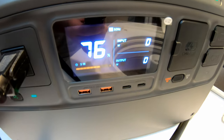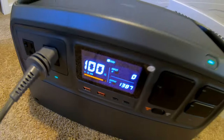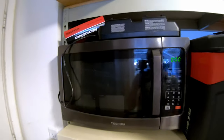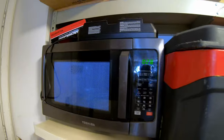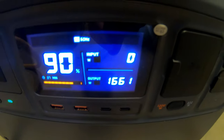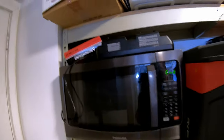Can the DJI Power 1000 run a full-size household vacuum cleaner? It has quite a bit of surge, though not as much as the dryer — I'm optimistic. Piece of cake, pulling just under 1400 watts. Can it run a microwave? The microwave is in my garage just for testing. Three, two, one — no struggle at all, pulling 1600 watts. This is the loudest I've heard this power station, but even still it's quieter than the microwave itself. Ran it for a full 30 seconds — piece of cake.